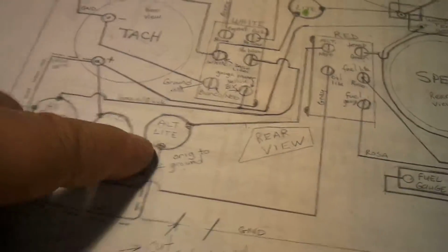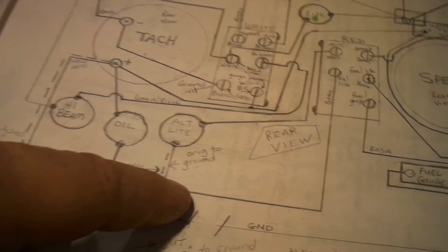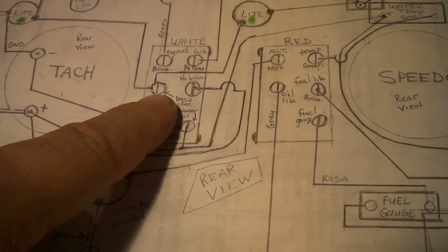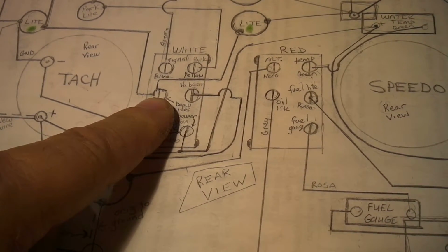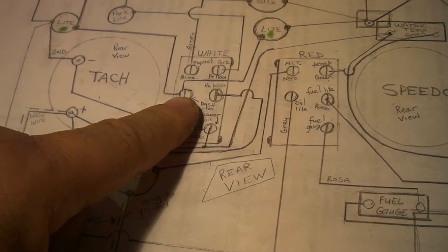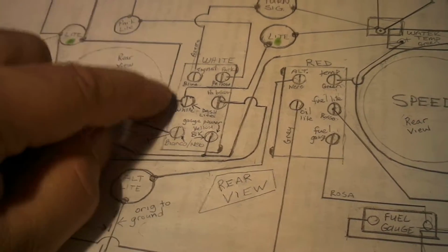and plus I had some modifications to do with the alternator change that I made instead of a generator. So I drew this up and made some changes, but this is the white wire that powers up the gauge lights. So somehow I'm going to figure out, maybe by the switch, if I can get to it without taking the dash apart, to connect a wire from these two new gauges to these lights, the instrument cluster lighting.